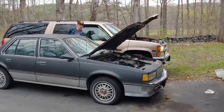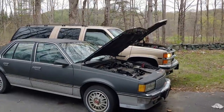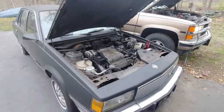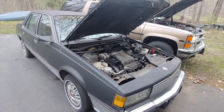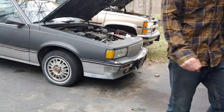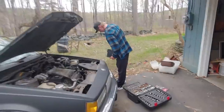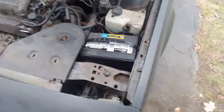I'm back with Jeb now. He's gonna try to start the Cimarron after it's been charging for about five or eight minutes. Multiple attempts — nothing. It ain't gonna go. We decide to just take Jeb's Suburban battery and put it in the Cimarron, because the Cimarron's not holding the charge. We got the Suburban battery out and slid it in — it's a little bigger but we got it squeezed in there.